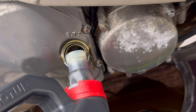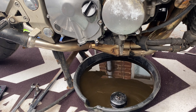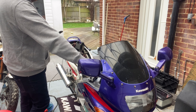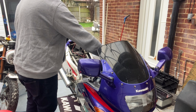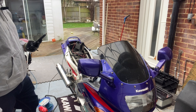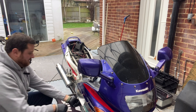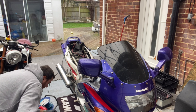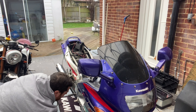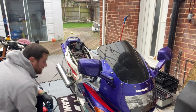It's 3.7 liters. So that's the oil in the bike and filter in the bike - I think we are pretty much ready to start it, get the oil warmed up, then check the level. The oil level's definitely dropped, which means the filter is now full. We'll pull the dipstick back off and top it up a little bit more - that should be golden. I've left it about halfway and that way when it's warmed up we should be in a good position. Let's start up again.